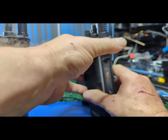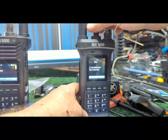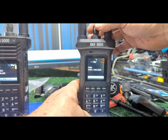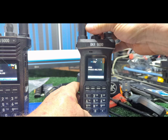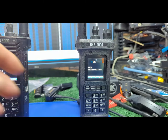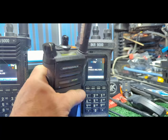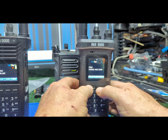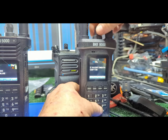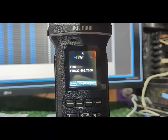I have to get the continuous knob because my zones have more than 16 channels — this one's got like 100. With FRS there are 22 channels; I don't want to have that in two zones or use two buttons to scroll through. That's where this blows out the Motorola and others. With the lock knob — I know the forest service loves those locked knobs — there are ways: hard stop, soft stop. It's like an endless knob with just a soft stop.